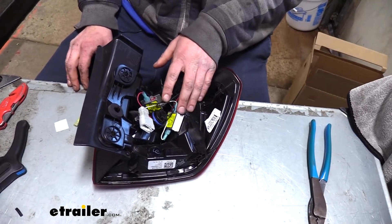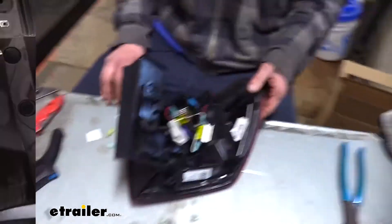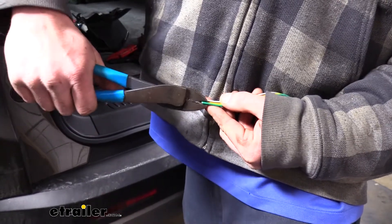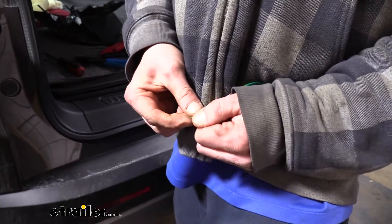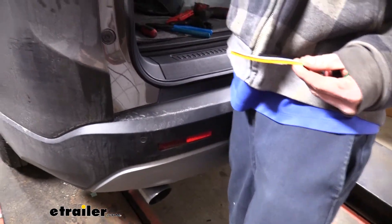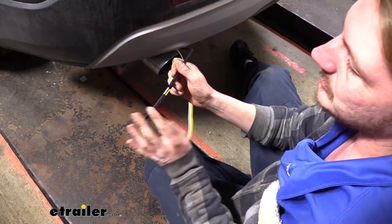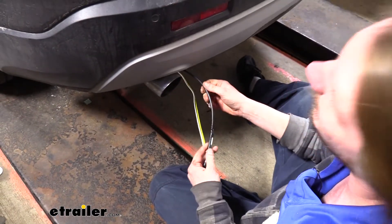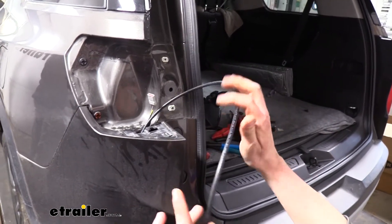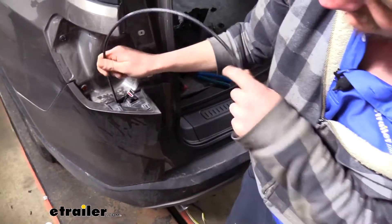We're going to do the exact same thing on our passenger side taillight, then start running our wire up to the diodes. Before we do, we want to isolate the green wire — we'll just snip in between the yellow and the green to let us peel back the green wire. We'll peel this back until we've got enough length to pull all these wires up to where our driver's side taillight assembly is. We only need these three wires on our driver's side; the green one we're going to route over to the passenger side. We taped the three wires we need to a fish wire — you can use a metal coat hanger or anything that's stiff but still flexible — and then pull our wires up to where we can start making our connections.